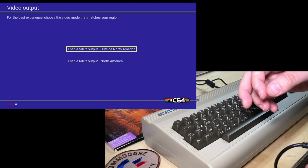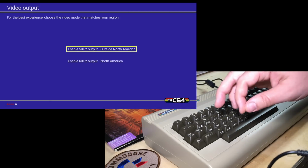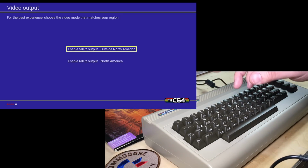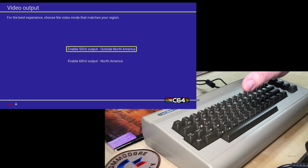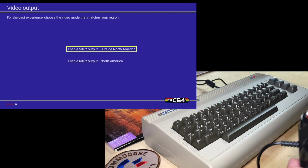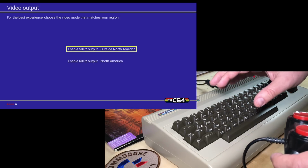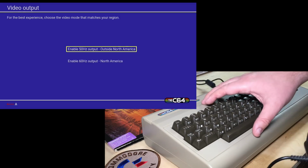This is where you get to choose the video output. This has caused some controversy, some trouble. It's been working perfectly for me, but this is a very critical step where you choose either 50 Hz or 60 Hz for the video output over the HDMI. If you choose the wrong value, then the C64 may not behave the way you remember, and that's because the NTSC over here in North America C64 experience was based on a 60 Hertz video output, this choice here, and in Europe, Australia, New Zealand, etc., it was PAL, 50 Hertz. And this fundamentally changes how a lot of games behave, so it's very important that you choose the correct one.